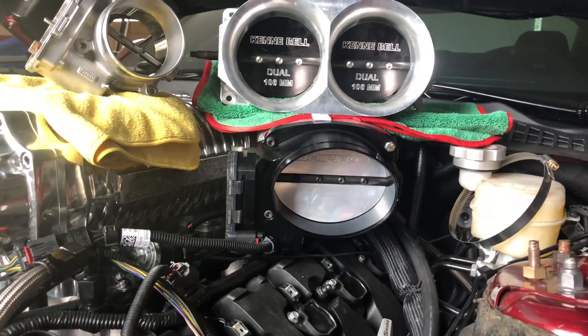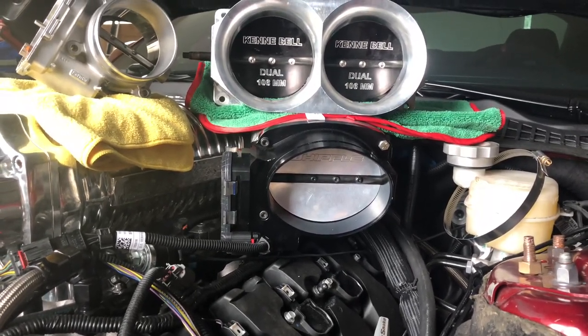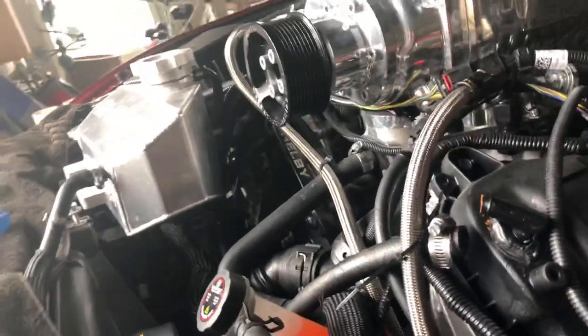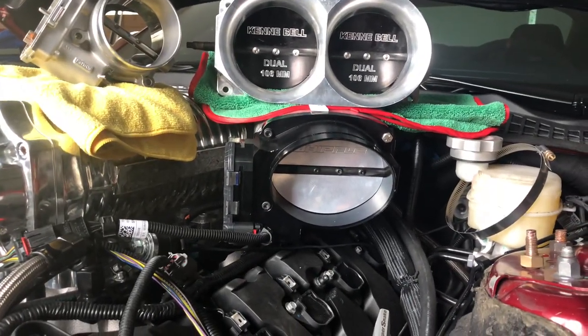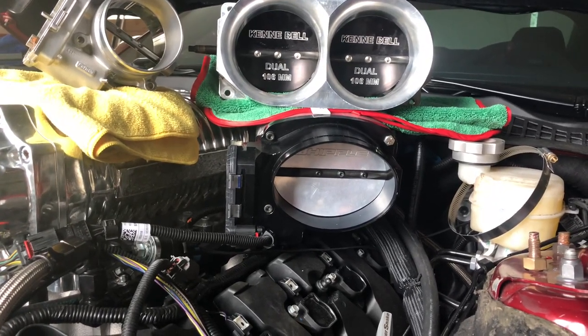Like I say, it made 1242 but we blew a blower belt — the pulleys are off a few. I've got spacers coming in. As you can see, I've got most of the pulleys and junk off the car, torn down right now. I've got to brace the alternator and put some spacing on it, and space out the other pulley about 0.15.